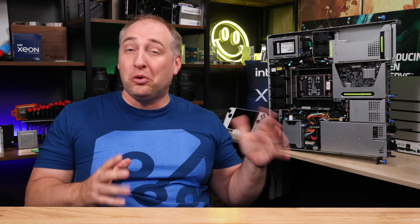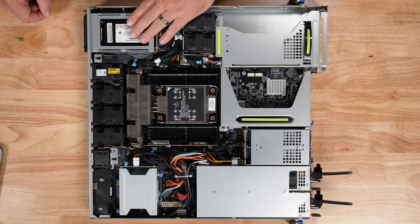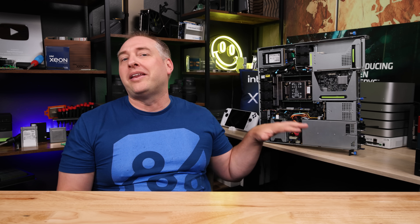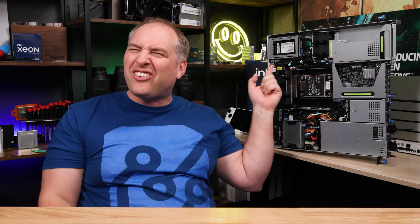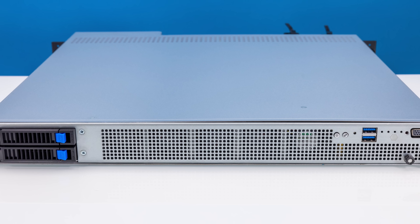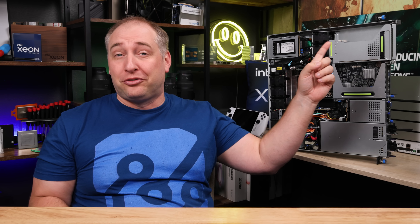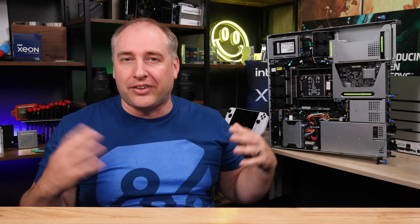The cooling is really interesting as well. Up top in the middle of the chassis there are two dual fan modules, then four more dual fan modules in the middle section, and a single fan where that's all they could fit. The SATA drives and power supplies at the bottom are cooled by the power supply fans. It also looks like you can reconfigure the rack ears — there appear to be another set of holes allowing you to move the rack ears from front to back using three screws, and of course rails are available too.